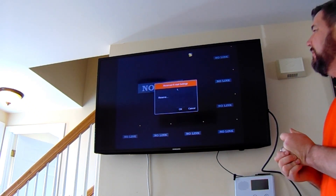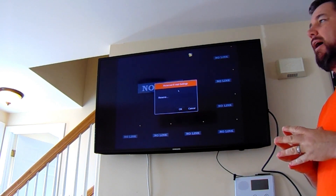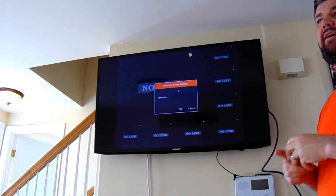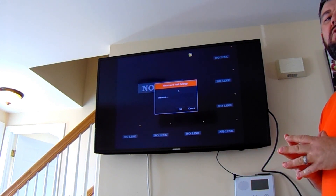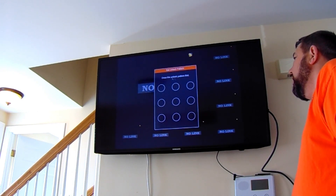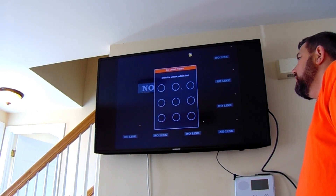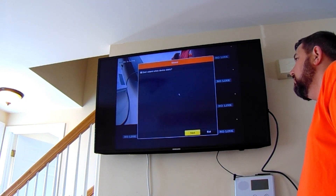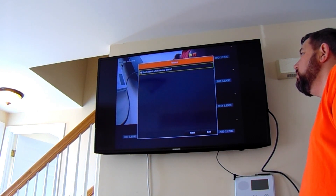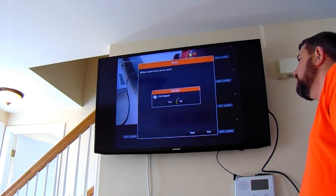It's going to ask for a reserved email for your account, which again goes to the GUID backup. We're not going to do that — hit cancel. If you reference that previous link it will show you what to do in the event you forget your password; you don't need to give up your information here. Next it says to draw an unlock pattern. If you want an unlock pattern like on your cell phone you can do a Z, a 7, or a T — whatever you want. If you don't want to do it, just right-click. It's going to ask if you want to start the device wizard every time the recorder starts up — I would say no to that, it's annoying. Then hit exit and we'll exit the wizard.